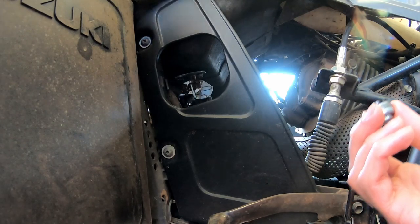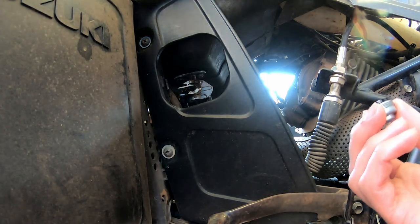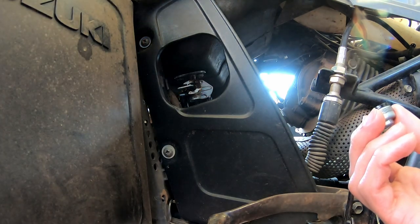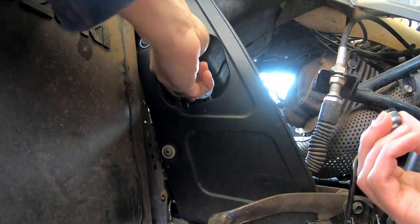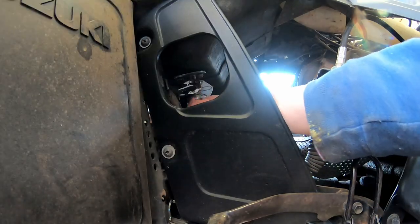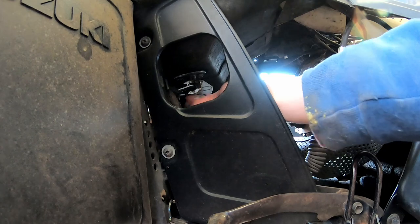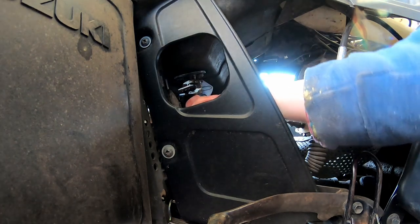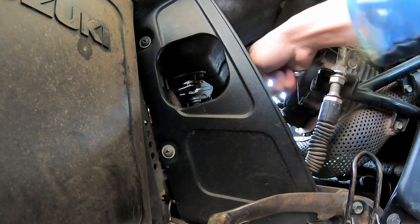Yep, the fuel's definitely coming out. So off shouldn't... maybe I guess I could see a little coming out, but the main point is that you can leave it on and no fuel will come out unless the engine's running. So the petcock is not the culprit. Petcock is working fine. So that means we can continue our journey and keep following the fuel system.